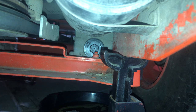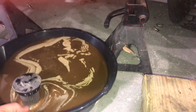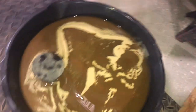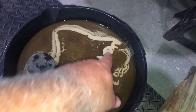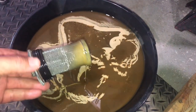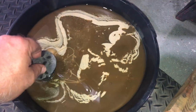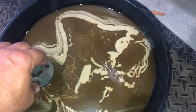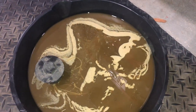Let's go ahead and take a look at this fluid — yeah, there's some nastiness in there. I'm going to assume condensation and water that got mixed in. The filter element itself, you can't really tell about those. By the hours, this transmission has 240 hours, so we're going to be glad to replace all of this.